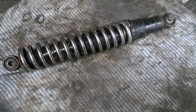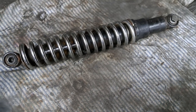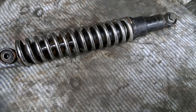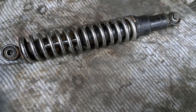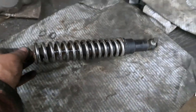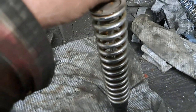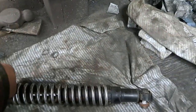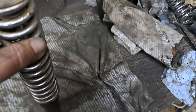I have had these before where they were stored in a prone position like this for years. And when I went to test them, they didn't work — there was no resistance. But after having them standing upright for about 15 minutes, I tried again and lo and behold, the shocks worked. So I went ahead and cleaned them up. These are pretty simple to get apart.